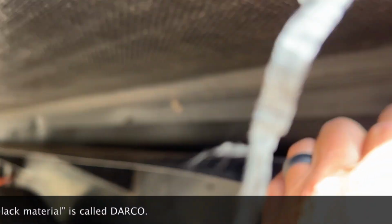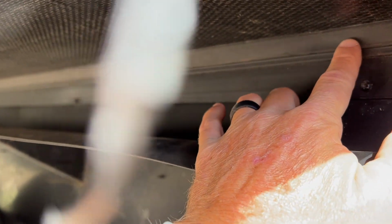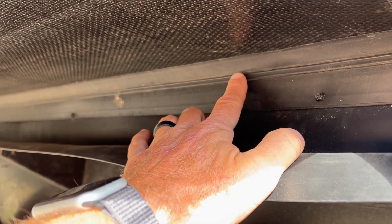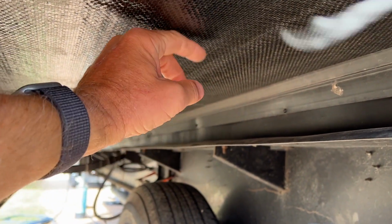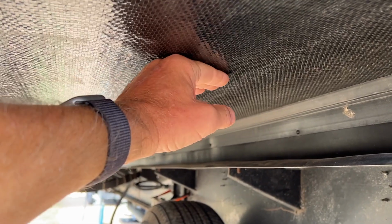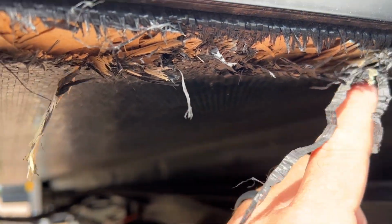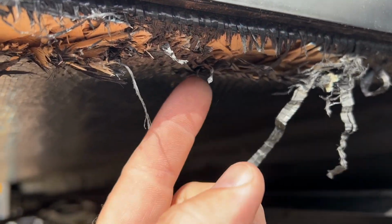Now, what's happening is underneath this dust flap is a threshold. There are no rollers, so the slide out basically sits on the threshold and slides on this material when the slide is pulled in or out. But somewhere along the way it started catching and tearing some of the material, and then it got down to the plywood itself.